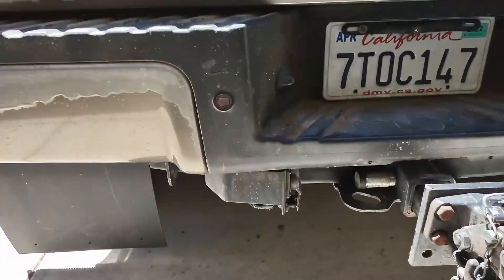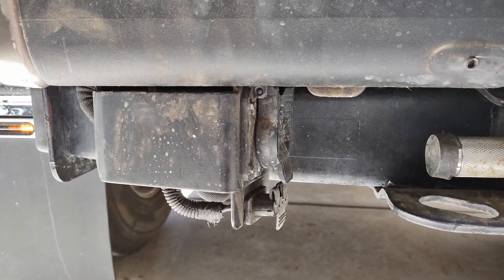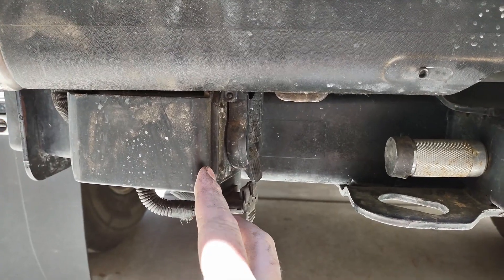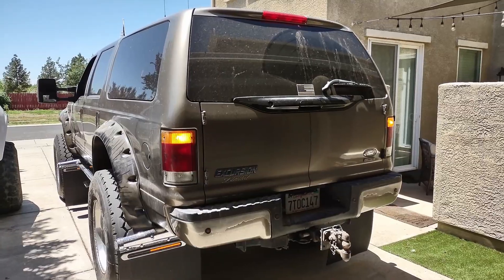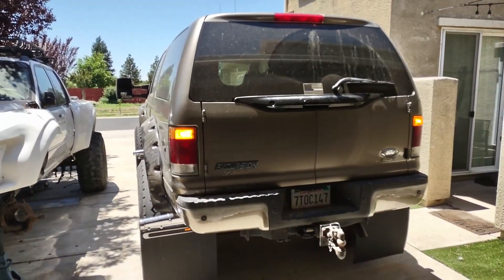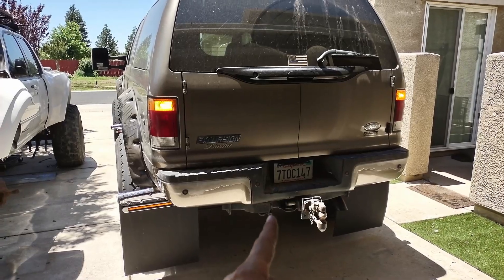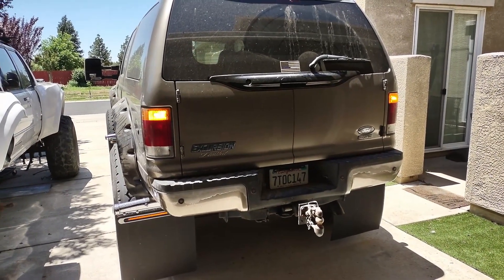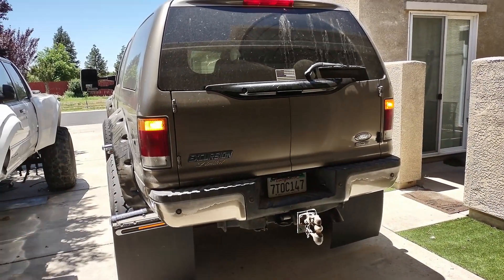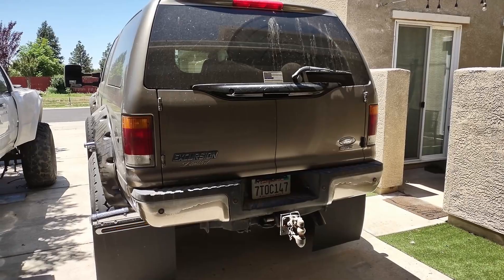When you've got your trailer tow plug — factory four-pin and seven-pin — because the system ran off the three-wire tail/brake/turn, this no longer has the function of tail, stop, and turn combined. One alternative: instead of doing the steering column cut wire at the multi-function switch, you could use a single converter box at the back and run it to each of the lights. That would retain your factory wiring. One unintended consequence of using the single converter box for the ambers is you would have a red hazard and a yellow turn, because of the diodes in those little signal converter boxes. This method is the most robust and retains the yellow hazard.